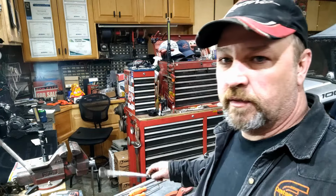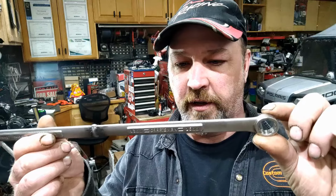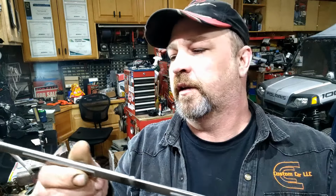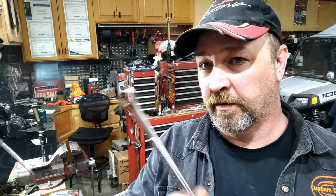So next, I have this wrench that I made. It's a 15 on one end and an 18 on the other. And back in the day for the TH125s and the 440 transmissions, this worked really good for bell housing bolts, especially the torque converter bolts because they were really thin. And I could get this wrench up in there and get them out. I've actually had so much torque on it over the years, like it's bent it right here a little bit.